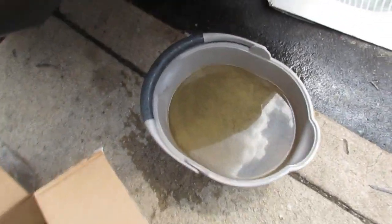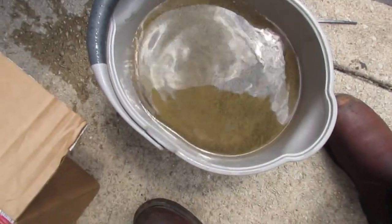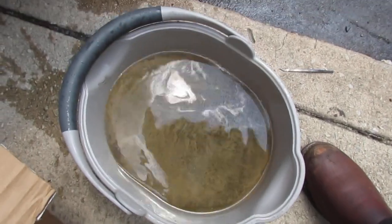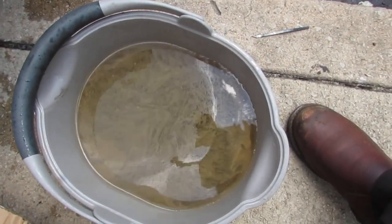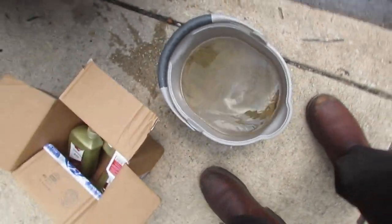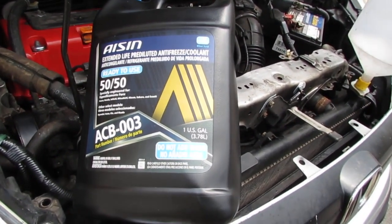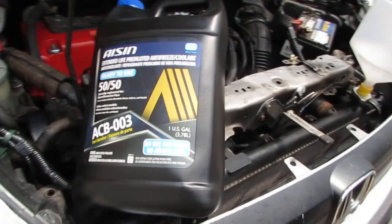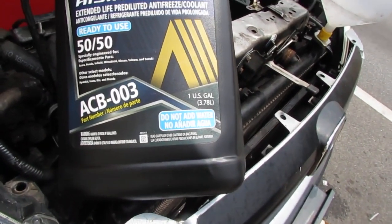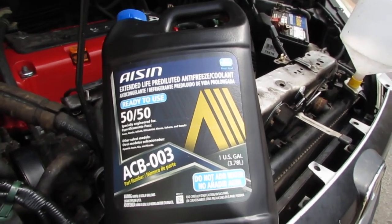So that's what came out of the coolant drain the first time around. I'm only going to do one. I thought I'd do two, but I only really need to do one. This got pretty clear at the end. Then we're going to replace it with this coolant. It's a 50-50. It's already got the water, it's already mixed, so no need to add any water. So that's what we're going to use for a coolant. I'll put a link in the description.